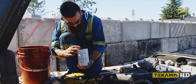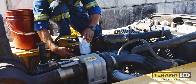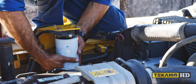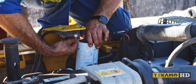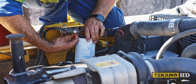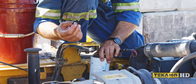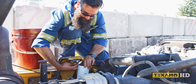Here we have our new fuel filter. I've lubricated the o-ring with some fuel and it's been primed the proper way. We just need to make sure the seal is in place — it is. There's not really an o-ring, more like a square ring, and we're going to change this every time we do the filter. There's just no point in leaving it on there — don't be lazy, just change it.